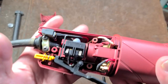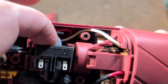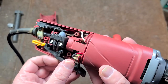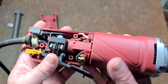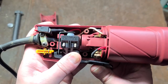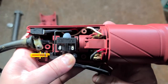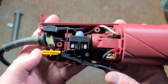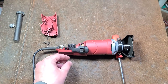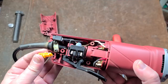Internally, things are actually looking a little better. We do have a switch which has a little rubber dome to prevent grit from getting in there — that seems like a halfway decent switch. We've got our lever mechanism. How this works is it pivots right here: when you press it, it's pulling down on this steel finger, which activates the switch. The spring-loaded things fall apart — love it.